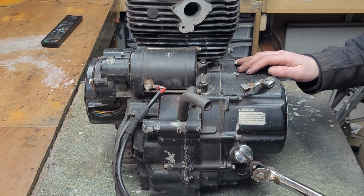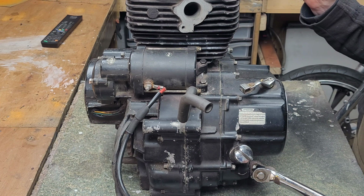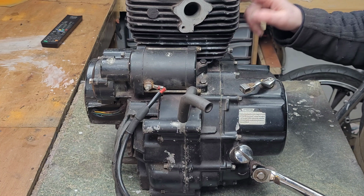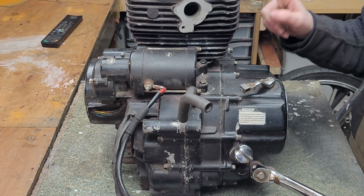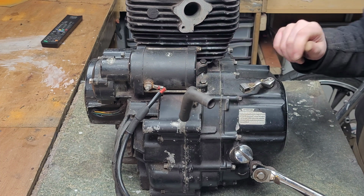We also get what's called blow-by, and again, no engine's piston rings seal perfectly, so we do get leakage from the combustion chamber past the piston rings and into the crankcase. So again, it's important that we let this out.